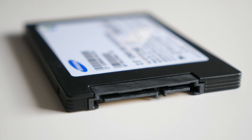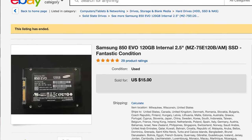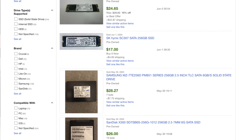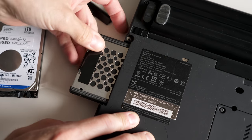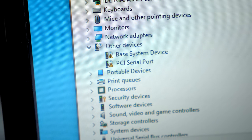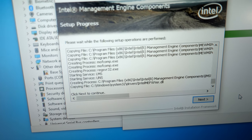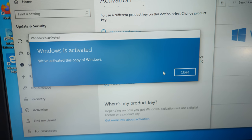To replace it, I picked up a used SATA SSD — specifically a 128GB drive that's the OEM equivalent to a Samsung 830. It's by no means the latest and greatest in SSD technology, but it's still a decent drive, and any improvement would be welcome. Drives like this have become really inexpensive, and used 256GB drives sell for only a little bit more. While Linux is great, I decided to install Windows on the drive, as that's what I think a lot of people would be more comfortable and productive with. It would also give a better picture as to how this machine's performance compares to modern laptops. Windows 10 installed smoothly and had the drivers for almost everything built in. The only ones I needed to find myself were for the Intel vPro management and, weirdly enough, the SD card reader. This X220 originally shipped with Windows 7 Pro, and conveniently, the product key on the machine was able to activate the Windows 10 installation, so this thing is totally legit.